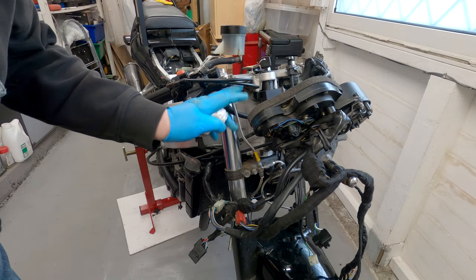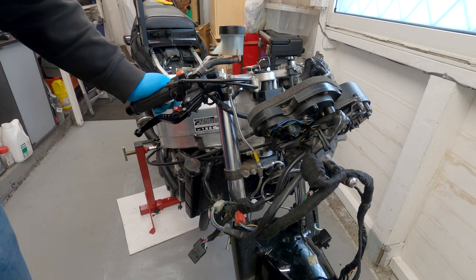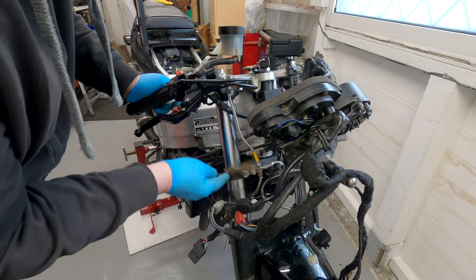There's a little bit of corrosion on the inside on some of the bolts. To do a proper job, I should take them all off, wire brush them, and in reality should probably replate them. But they're not actually that bad, so all I'm going to do for now is give them a quick wire brushing, give them a blow off, and put some wax oil on, but not the yellow wax oil can. This is the stuff from Genolite. That way it's not quite as visible, but it gives a much better coating than, say, just spraying it with WD-40. And that'll certainly stop the corrosion getting any worse for the next few years, because in reality, I'm not going to use this during really bad weather. So, just a quick brush.